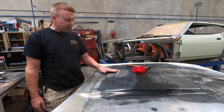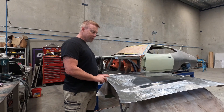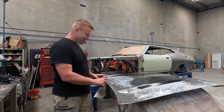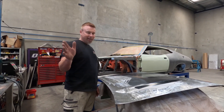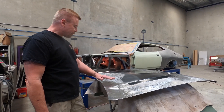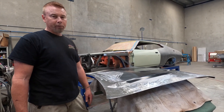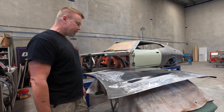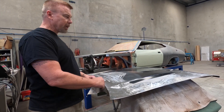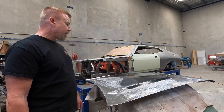We had a little bit of a snafu while filming that introduction - the battery went flat. Blake's holding the camera, so Blake has to take the blame as usual. During that time I finished the heat shrinking, got it all pretty flat, then went over it with 40 grit on a flappy disc sander and basically got the bonnet all keyed and ready to put a skim coat of filler over it.